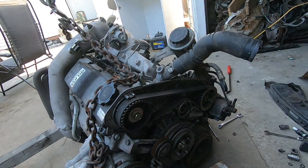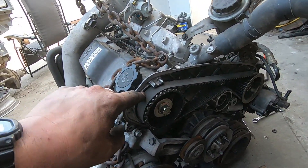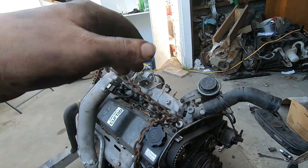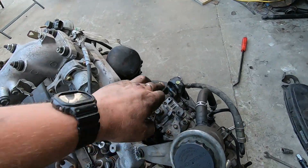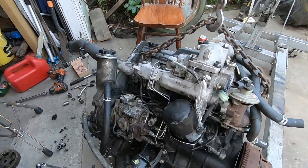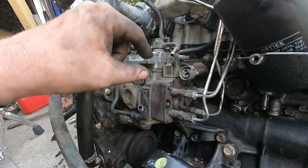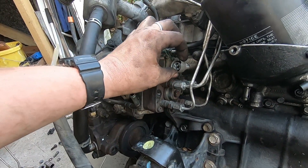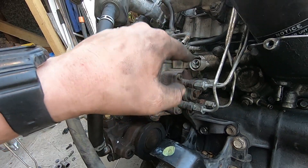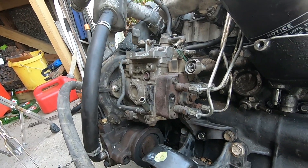I've rotated it by the crank — it's turned the cam and the injector pump in return, and my lines are right on the money on both marks. Now I'm going to fit the bell housing and starter motor, then run a fuel hose to it, get a battery and some jumper cables, and try and crank it over. What I need to do is find which wire is going to be the fuel on/off solenoid. There are only three wires on this injector pump — one of them is probably a tacho signal for the rev counter, but I'll just probe 12 volts around until I hear a click, which will tell me the solenoid is clicking open and shut, and I'll run 12 volts to that.